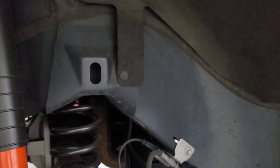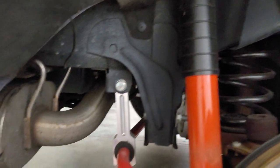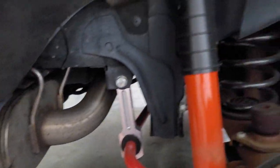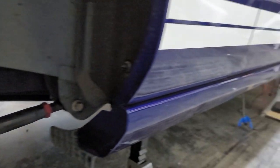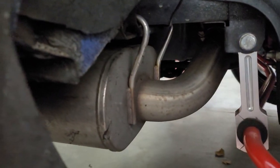All right, everyone. What I found out, the best way to do is to work backwards. Start with your rear lights first. That way you know the length that you need to run the side and up to the front. You got plenty from side to front. It's just when you get into the rear, your real estate's getting a little short.